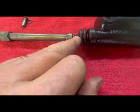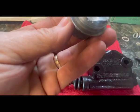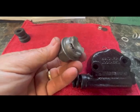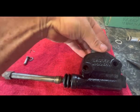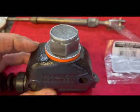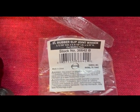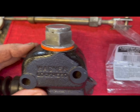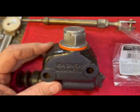I did have one thing I'm going to show you here. The filler cap, when you took it off, did not have any gasket or o-ring or anything on there. Not quite sure if it needed one at this point — I do believe it does when I looked further on there, but I didn't have one. I called around at a local dealership. Of course they don't have any parts for a shovel head, but hey, you never know. I ran down to Ace Hardware, brought the cap with me, and I found this little rubber gasket here. It's a little probably thicker than it needed to be, but until I get the correct one, it'll keep the moisture out, keep the trash out, keep it sealed down tight — and it was like 39 cents. How could I go wrong with that? I figured getting something on there to keep it from being contaminated while I get the fluid in there would work just fine. Got to love Ace Hardware sometimes.